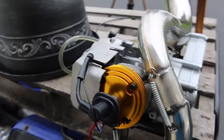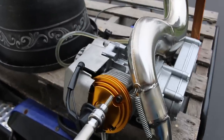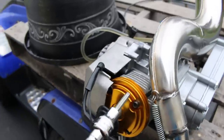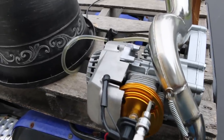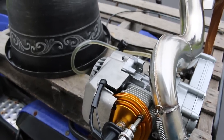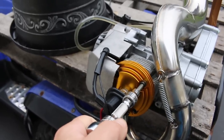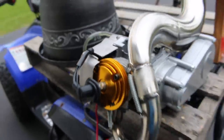Moving on to my next tip: once you get a good run cycle on the engine — like how I just ran it for 10 minutes and got it nice and warm — you want to let the engine completely cool and then go for a tighten on your cylinder head. These four Allen heads right here. I've already done that for this engine; I let it rest for 24 hours after running it the first time and went for just a nice snug on each of these bolts. With heat and running an engine for the first time, this can actually loosen up. Don't go for full turns — they should already be tight — but this reassures everything isn't going to leak out of your cylinder. You can also check your exhaust Allen heads, and with vibration it's not a bad idea to run through more of your screws than just on the cylinder.